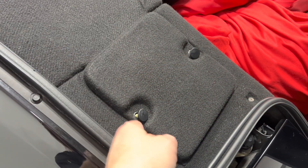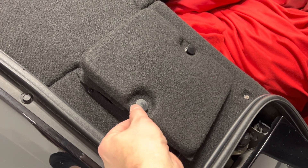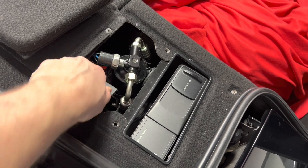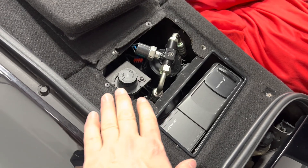I'm about to get into the car and get the immobilizer out. First I'm going to go in the bonnet and disconnect the battery - when messing with electronics I like to do that. One thing you need to know on an OBD2 car: when you kill the battery switch you wipe out the readiness monitors. If you're going for an inspection they need to be active, which can take about 50 miles of drive cycles. On the passenger side there's a little access panel with thumb screws and right below is the battery switch - I'll turn that off.